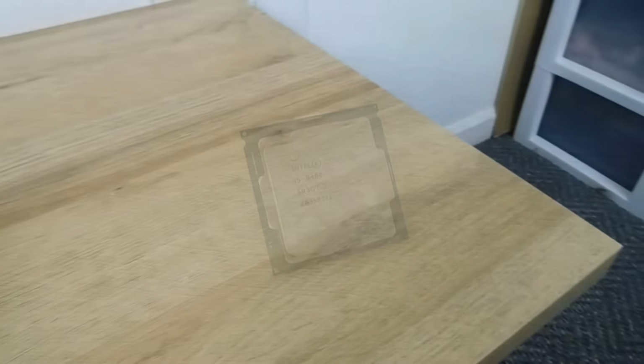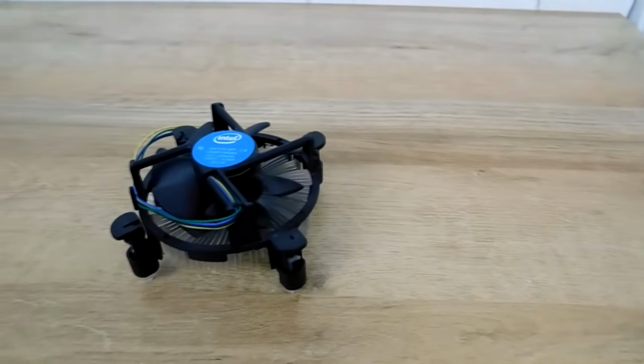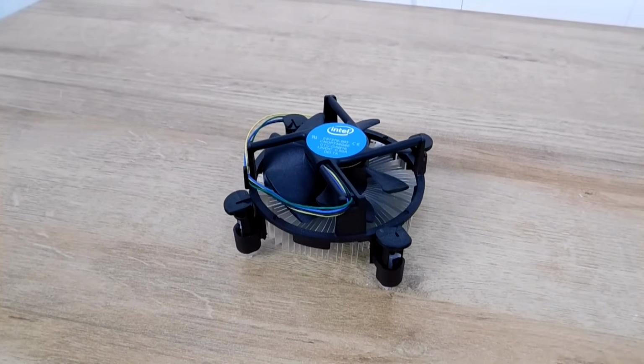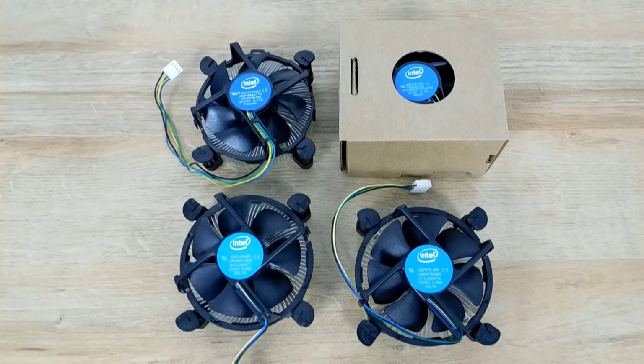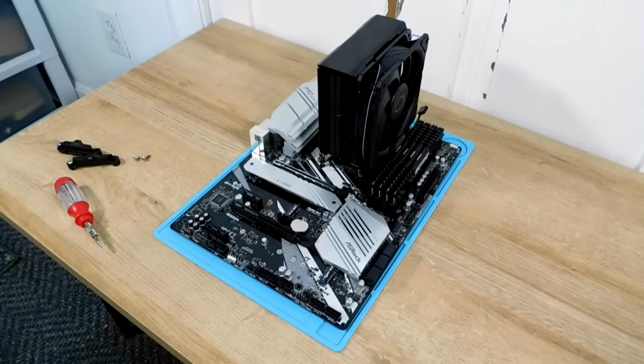That is fairly low, and the reality is we don't need a crazy heatsink with copper heat pipes to keep it cool. Now, I swear I'm not going for the stock Intel heatsink here just because I have multiple ones. Wait, actually, yeah, I am. Let me explain. The stock Intel heatsink is more than enough for our CPU here because of the low TDP and for the simple design that was made to clip on our cooler to the motherboard. But more importantly, because we don't need to spend a lot of money on a fancy CPU heatsink right now.